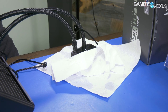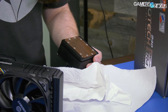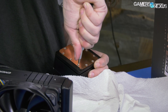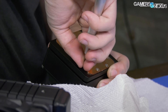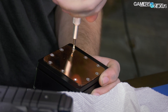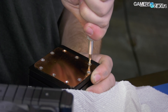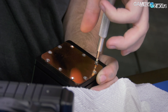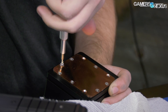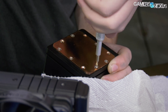Now for the cold plate — TR9 or TR10 is what we want. It's TR-20 for the big ones on the sides, TR-10 right here. Hopefully this is easier than the Asetek ones. The Asetek ones are a nightmare to get the cold plate off because they're so torqued to prevent leakage, and the softness of the screws means it's very easy to strip them and you basically have to drill it out. But this looks like it's assembled in a way that you should actually be able to service it.